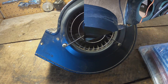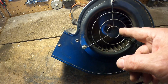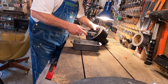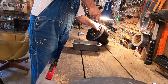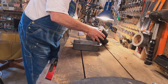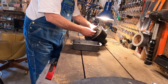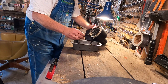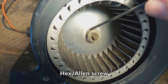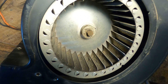Let's take it to the workbench. I think I'm starting with the simplest thing first, so let me take this cover off and see about blowing out the squirrel cage. There's a collar on this shaft coming through there. There's one screw already loosened. Typical vintage Mercedes — it's been taken care of through its lifetime. Look at this collar — loose. Looks like you undo this hex or Allen little bolt here — there's a three millimeter. Let's undo it and see if we can't slide the squirrel cage out.